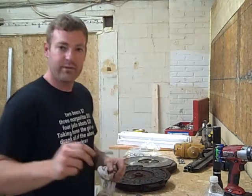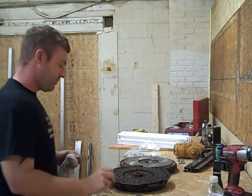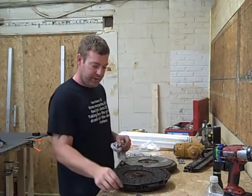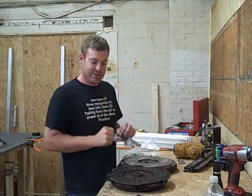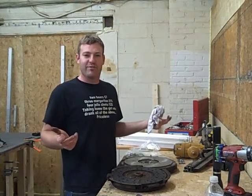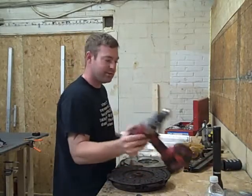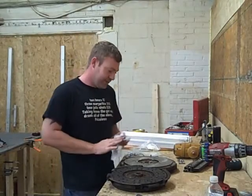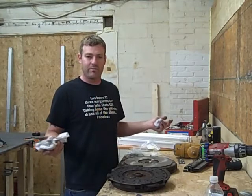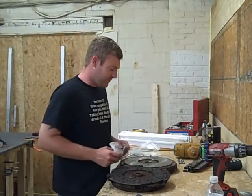Here's the rasp I mentioned earlier in the video — that's what I used to remove the pilot bearing. You can pump it out with grease and find a dowel rod to punch in there, but that was going to take me like a half hour just to find the right dowel rod. The rasp took about 10 minutes with an 18-volt drill. If you've got a die grinder it'll be even quicker. I'm sure they make a proper pilot bearing removal tool, but this worked great.